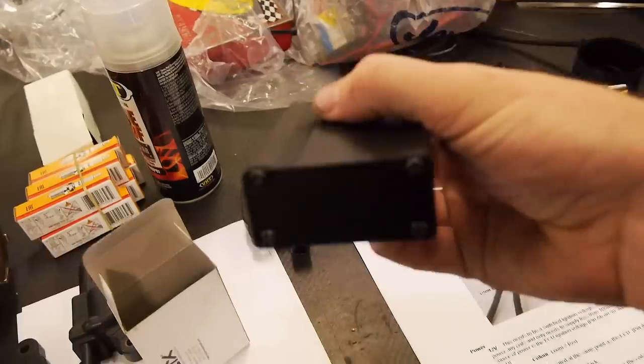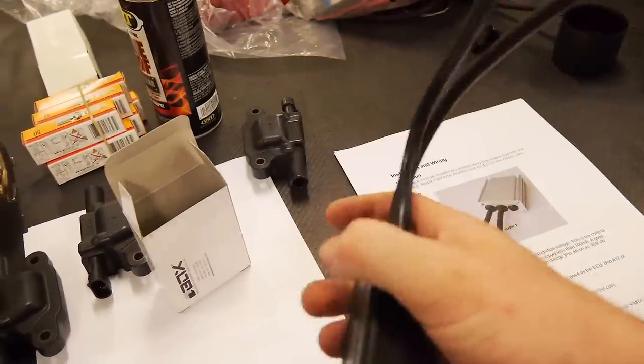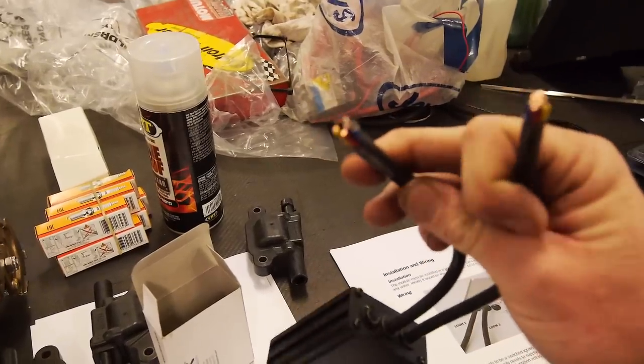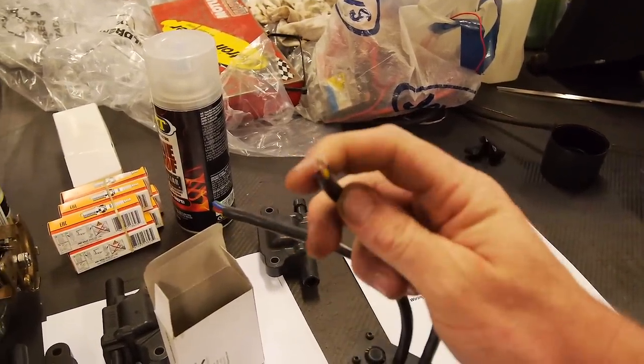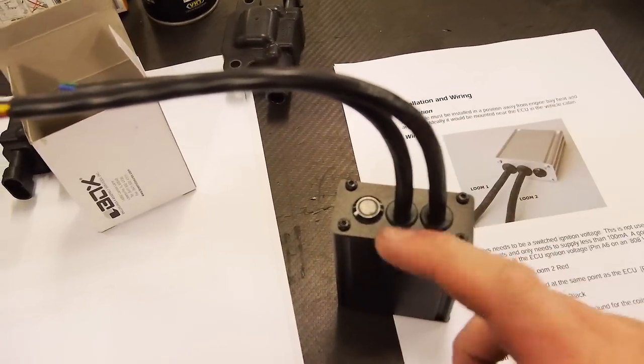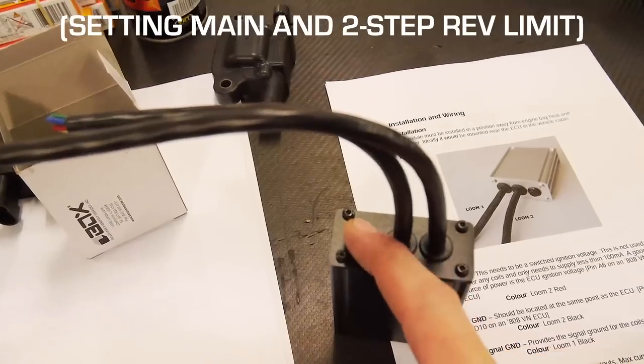This is it - a really nice polished package. We've got all our signals in and our 6 coils out. And then we've got a little button for rev limit and for 2-step. The really cool thing I'm looking forward to is you can do a random spark cut rev limiter or 2-step, which is like the classic ones with all the pops and bangs and crackles.